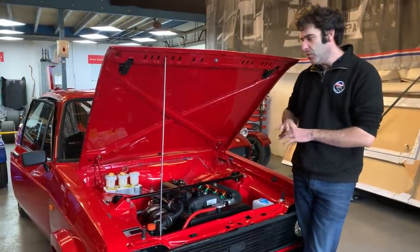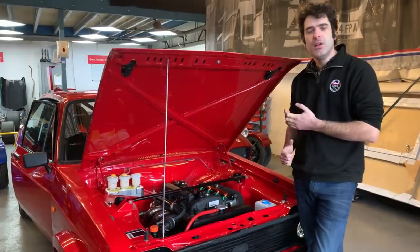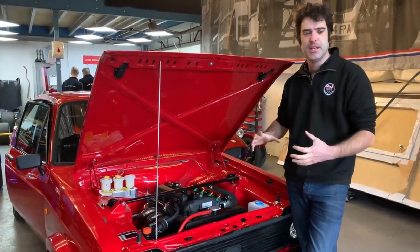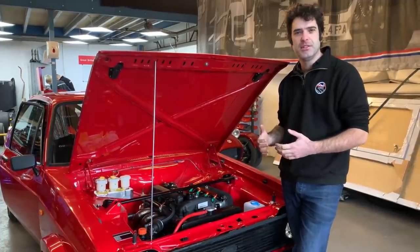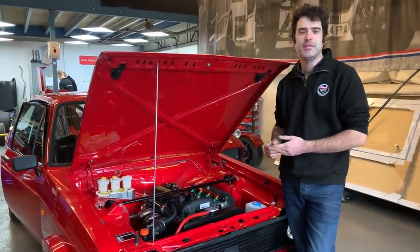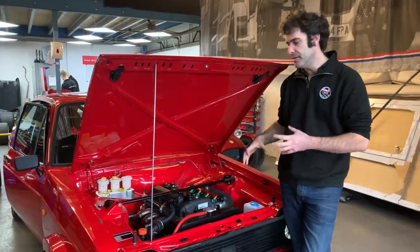On the car, the whole electronics have been looked at and we've designed a custom loom — so there's no fuse box, relays, or anything on the car. We're using a full PDM, a power distribution module. This enables you to configure each driver channel and current loads, with a certain amount of programming and intelligence in the system. We can adapt the car as it grows, depending on what options the customer has — whether they're having central locking, electric windows, air-con, anything like that. It's all taken care of in the design work.